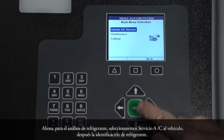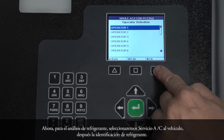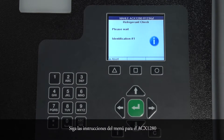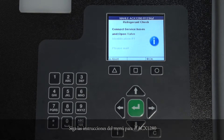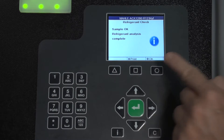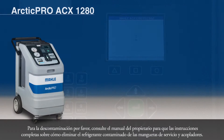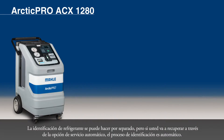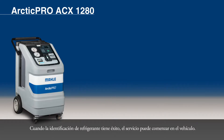In this case, start the flow of gas and then wait for 20 seconds before instructing the refrigerant identification unit to test the gas. Now, for refrigerant analysis, we will select Vehicle AC Service, then Refrigerant Identification. Follow the menu prompts for the ACX-1280. For decontamination, please refer to the Owner's Manual for complete directions on how to remove the contaminated refrigerant from the service hoses and couplers. Refrigerant ID can be done separately, but if you are going to recover through the Automatic Service option, the ID process is automatic. When the identification of refrigerant is successful, service may begin on the vehicle.